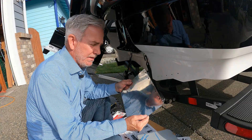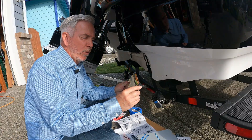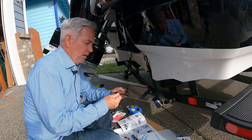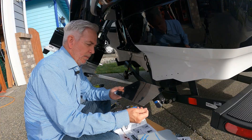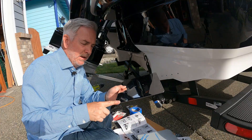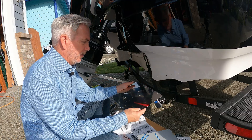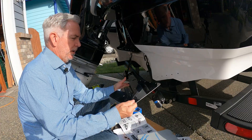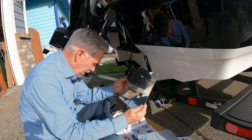I'm back. It's been about five or six minutes going around this whole thing on both sides. The entire thing was sharp all the way around — even in the corners, it was really sharp. If somebody would have bumped their hand or foot on that, they definitely would have potentially cut themselves. But I smoothed out and rounded out the edges with my fine file, and then came back with a 220-grit sandpaper block and really smoothed it out even a little bit more. I went around the entire thing with my finger to make sure there are absolutely no sharp spots. It looks like they are identically drilled, so just pick the best side face and choose that to be the upside.